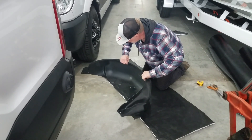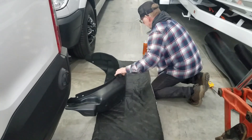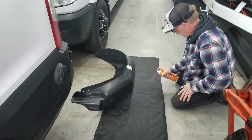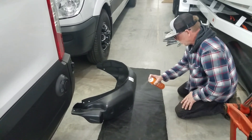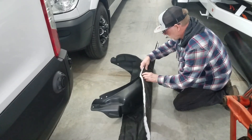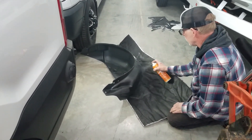I'm going to lay that down and kind of wrap this around, but then I'm going to have to cut some pieces out here. I'll continue to wrap the top part — spray some more adhesive on the liner. I need to let it air dry a little bit so it sticks. You can see where I've got a pleat that I'm going to have to cut out — I'm doing it in steps here so you can follow along.